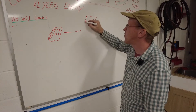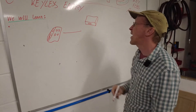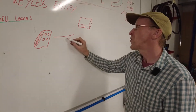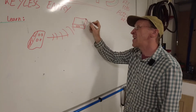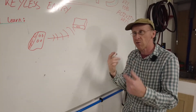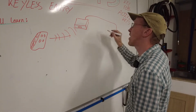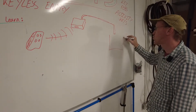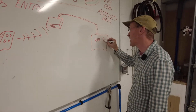So this goes to a little module that's in the headlining — we'll have a look where it is and what it looks like — it's a tiny little box with a little connector on it. That is what they call the radio receiver module. It sends out its radio waves, but this radio receiver doesn't actually have the address book in it; that's just doing the radio receiving part. It's then hardwired in the car to the KVM module.